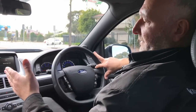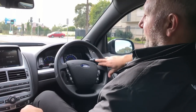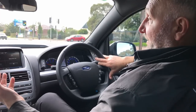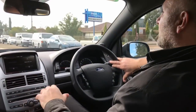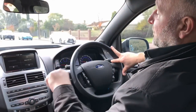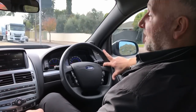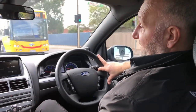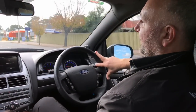A couple of things that we've needed to add onto this vehicle to support the amount of power that it's got. We've had to do the fuel system, so it's got the larger injectors. We've utilised the KBM 1000cc injectors. We need to supply those injectors with the fuel, so we've had to replace the fuel module in the tank with the StreetFighter 1000 horsepower fuel module. That is a direct replacement module that feeds cool, dense fuel straight to the engine.